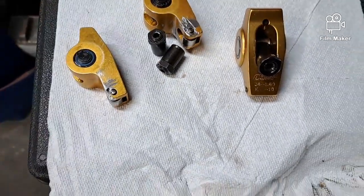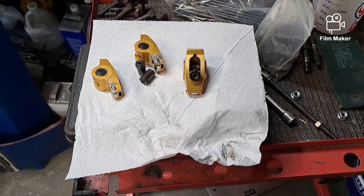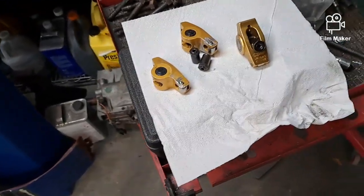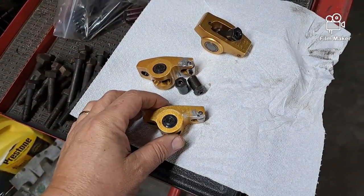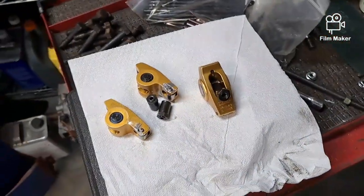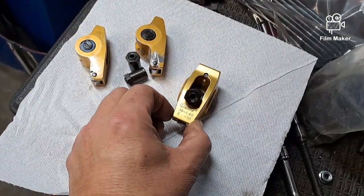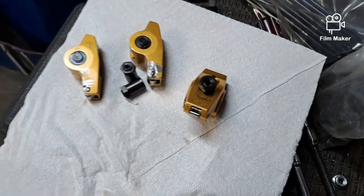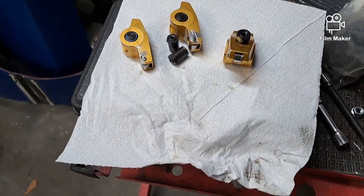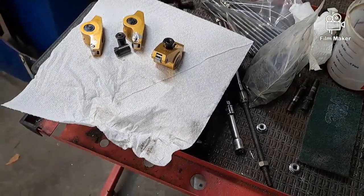One of these had a little bit of damage on it - nothing horrible, I just kind of smoothed it out a little bit. It looks like a valve broke. Oh yeah, that was the other thing - it had a box of Chevrolet valves. So apparently somebody back in the day had a small block Ford with Chevy valves in the heads, probably 351 heads. Putting Chevy valves in was a common trick back in the day before aftermarket heads were available. So I'm going to run these - I've got the springs still set up for 1.7 rockers on the stock cam.